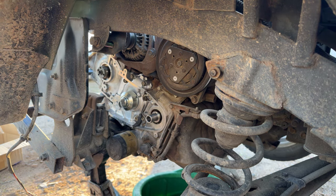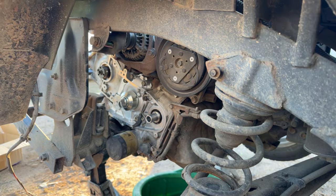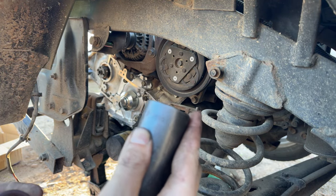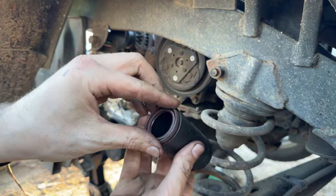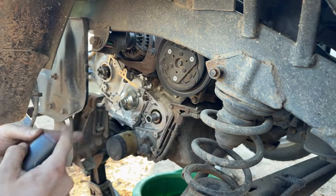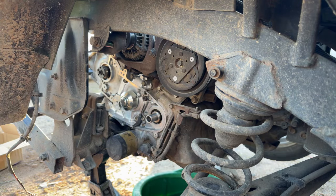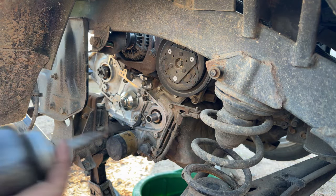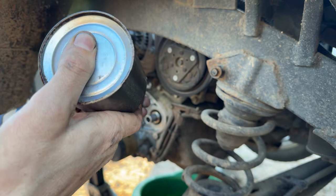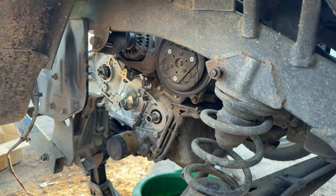All right, so for the crank, this probably will be more fitting, Miller C-3688. Just about the right size, but at least it's long enough to get over that crankshaft. So put a little bit of oil on the inside of that fresh seal. We'll run that around that inner lip just to help her slide on.